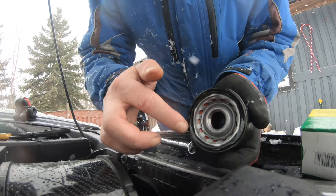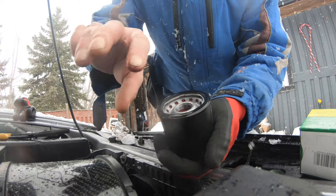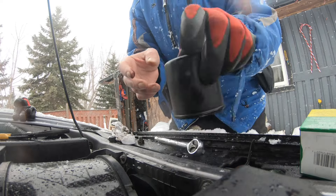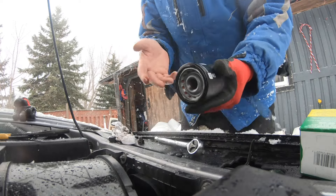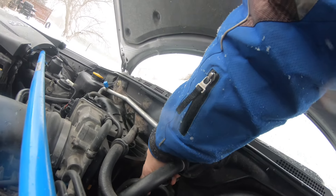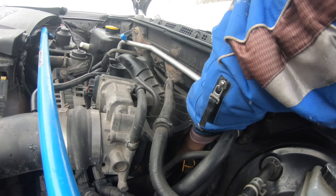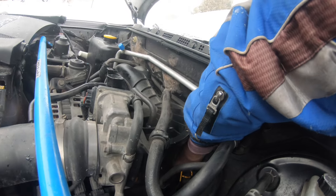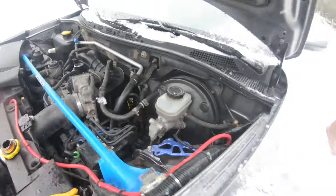My finger is wet — just wiping around here. Unfortunately you can't fill this filter with oil. Sometimes you can get away with doing that, but this filter actually goes on upside down. So if you even attempt to do it, you're going to dump oil everywhere in here. Make sure you get this hand tight, but tight. Okay, there we go — it's on there.